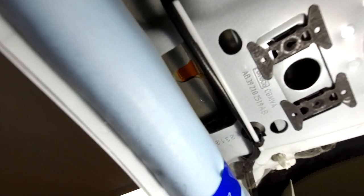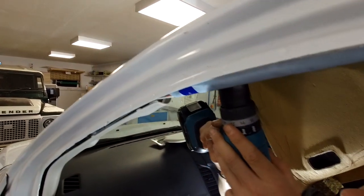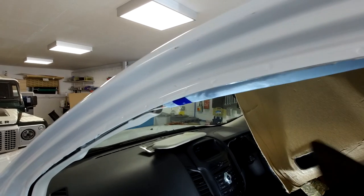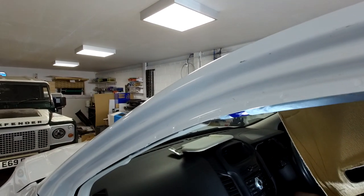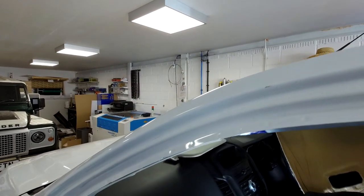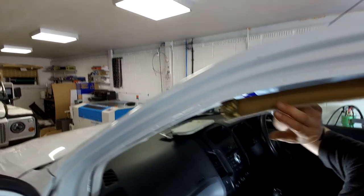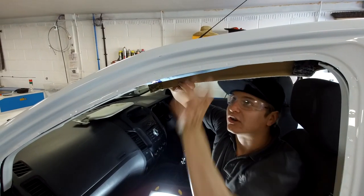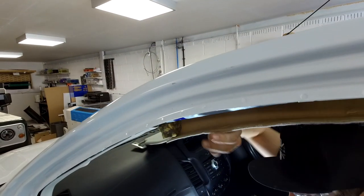The next hole — get the light in the right place — it's up at the roof skin, right up there. When you're in here you should be able to see it a bit better. We're attaching to multiple layers but only drilling through one, because of the way the mounting is designed. We can drill from the top or the bottom. Just make sure you don't drill too deep because of the curtain airbags.